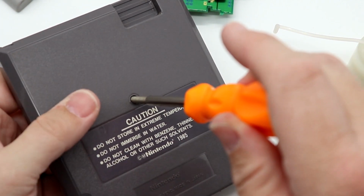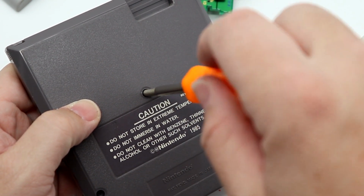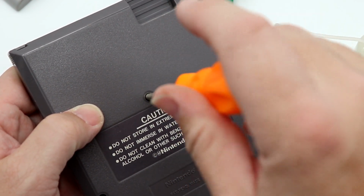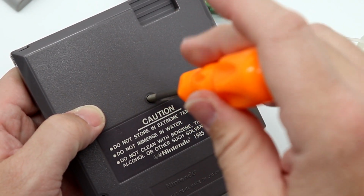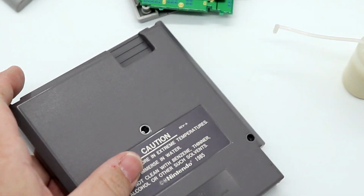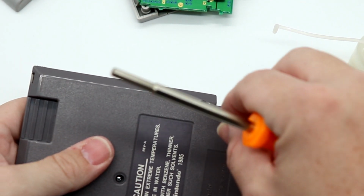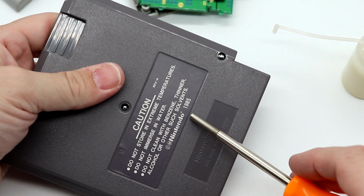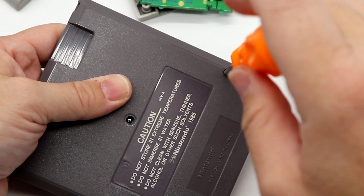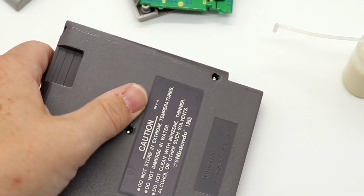One final tip here is you see me put the screws in the back of this and then into the Super Donkey Kong. Before you tighten down, unscrew slightly. You'll hear it click and take a set before you screw it back into place. Basically, that ensures you are using the same threads that are already cut into that plastic and that you are not cutting new threads. With these games, you see the copyright here of 1985, you're looking at 40 years old. That's some old plastic that you don't want to strip out. Or maybe you do. Maybe you're sick and twisted.